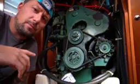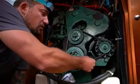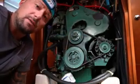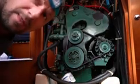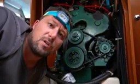So I'm about to do the engine check and the rigging check. Okay guys, so we're here with the engine, and what I also always like to check is on the front side, the tension of the belt. Seems to be pretty good. And then also check the timing belt to see if there's any damage or whatsoever. That's behind here. So there's nothing to see here, everything's fine.